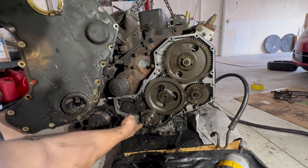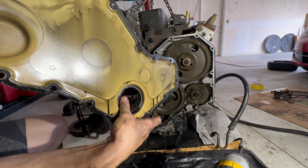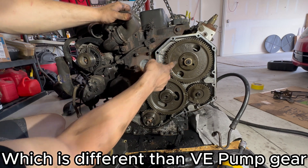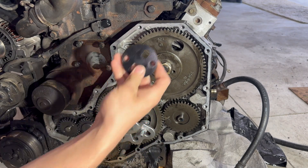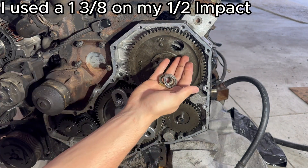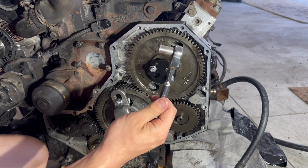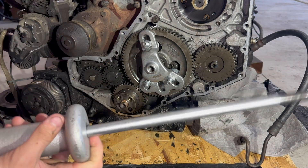As we pull this off you can see how much oil is leaking — this seal was leaking badly, so I'll definitely need a new one for the swap. Right here is your oil pump — I'm replacing this as well when I do the swap. This right here is the p-pump gear, so before we take the cam gear off we'll take the p-pump gear off first. I think you need a special puller — I bought it on Amazon for about $13, link in the description. It's super easy: take the nut and washer off, put your bolts through, and it comes off with just a little quarter-inch ratchet on 10mm bolts.